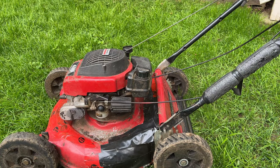As you can see, you just had to prime it a bunch of times, but this thing's ready to go. I can't say enough about this four horsepower Tecumseh engine. I've had Briggs in the past, the newer Briggs especially. They got a bunch of plastic in the carburetors. This four horse Tecumseh, I had to take the carb apart a couple times to clean it out because it had gotten some ethanol gummed up in there, but she's ready to go again.